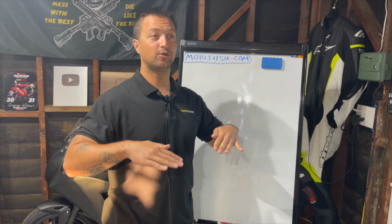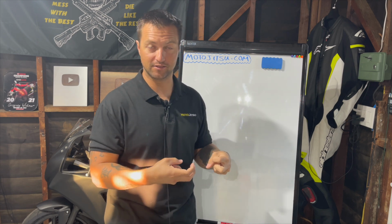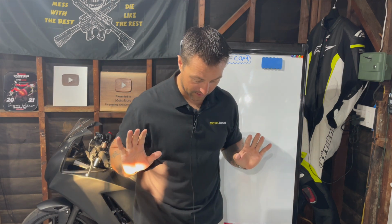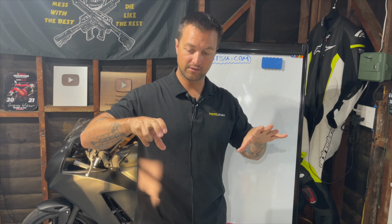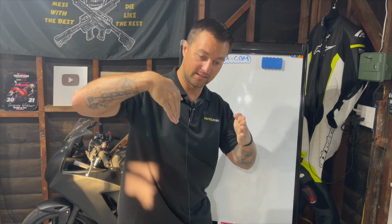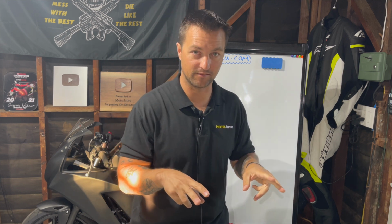But just in case you do have to stop at that speed, once you go above 40 miles per hour, in my experience, in my thousands of hours of practice: under 40 miles per hour, you just use the brakes. So this is what happens. All 4 extremities happen at the same time. You reach up, roll off the throttle to 0%, go up on the brakes and start squeezing the brakes. At the exact same time, you're pulling in the clutch all the way. And while you're stopping, always make sure you're in first gear before you stop, just in case the idiot behind you is not stopping, so you could take off and go.